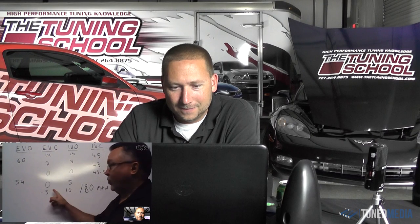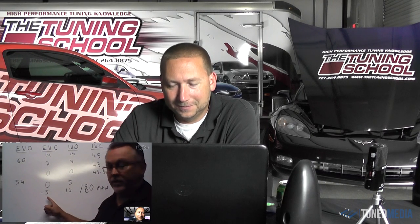Last thing we need to talk about is cam selection for turbos. Can we chat for just a minute about how that differs and what you see as common problems? I think the most common problem with turbo cams is guys thinking that an LS6 camshaft is the best turbo cam ever made, because it has negative 20 degrees of overlap. Well, if you've got a tiny turbo, then yeah, that works well. If you have a large turbo, you don't have enough overlap to help spool the turbo.